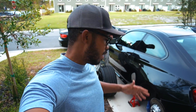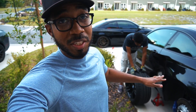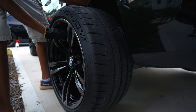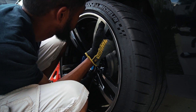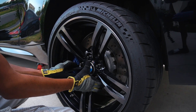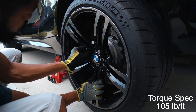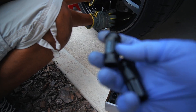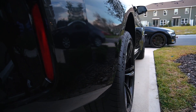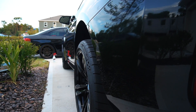So the hardest part of the setup is finally done — got the studs and spacers installed. Next step is to mount the wheel back on and install our racing nuts with the lock set. As we're installing the nuts, the torque spec on these is 105 pound-feet. The design on these is pretty nice — it has logo branding on it, and we also have the lock nut, which I'm going to be installing one on each side.